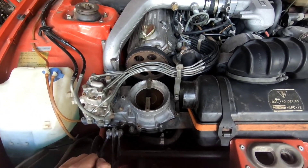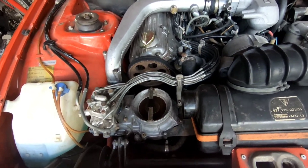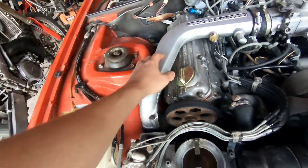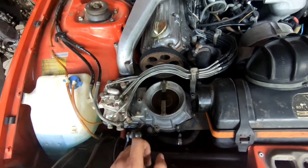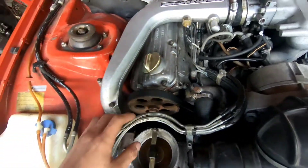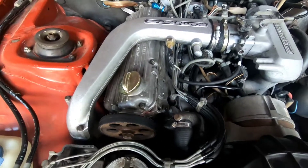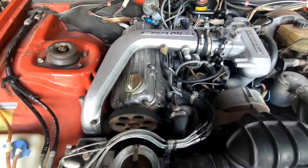The problems that arise from something not being correct in the system include cold starts and general how the car runs. Especially with this intake manifold leak, the turbo puts a certain pressure into the intake manifold. The system has already adjusted for that amount of pressure with fuel, meaning the high-pressure fuel pumps and injectors are already putting the calculated amount of fuel into the engine. But with this boost leak, we're seeing less air than what the fuel is regulated for. So basically we have a completely screwed up air-to-fuel ratio, which causes these cars to run incredibly poorly when something's not right. But when everything is correct, everything works great and there's no issues.